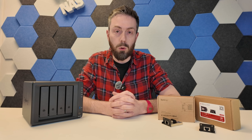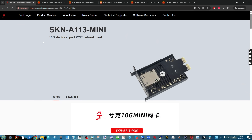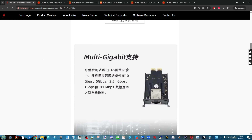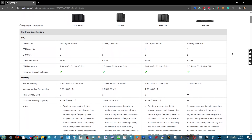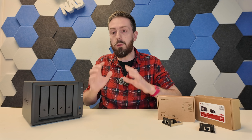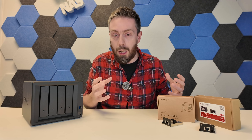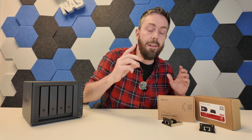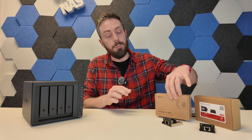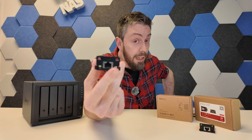Cropping up online for the last 12 months or so have been cheaper third-party alternatives to upgrades available from Synology for their NAS systems. Maybe you've purchased a DS923+, a DS723+, an RS422+, or the popular 5-bay DS1522+. Upgrading from standard 1 gigabit Ethernet to 10GBE up until about a year ago was only available one way — utilizing the E10G22T1 from Synology, a small mini PCIe upgrade that allowed you to add 10GBE.